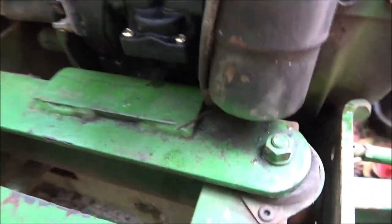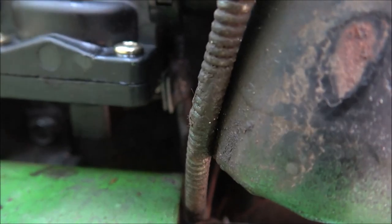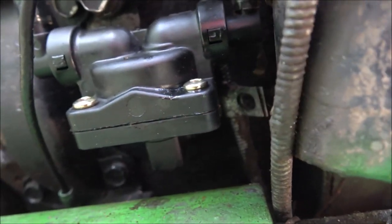Okay guys, I found the problem. My throttle cable comes right up behind there — there's my throttle cable. When I move it, the whole thing's moving. Right down in there, that piece is supposed to go where that bolt is. That's why my throttle wasn't working. I'm not going to fix that today — I am just too hot. Besides, I've got another package in there I need to check out, and that'll be the next video.